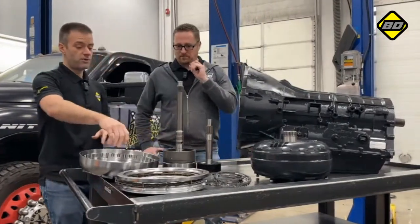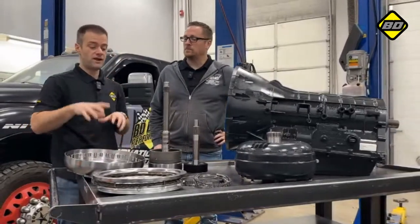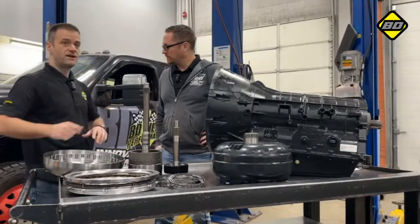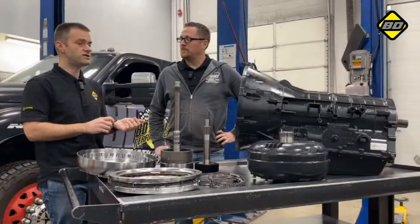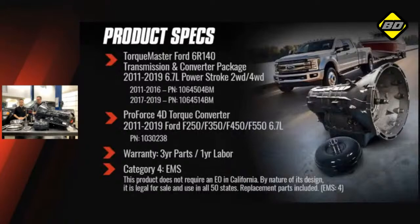One of the really neat features of our all-new converter is that it retains the factory functionality of the captive clutch assembly. Because we keep the factory damping, this converter drives just like a stock one. All our testing in the truck behind us confirms that from the seat of the truck you cannot tell the converter is a heavy-duty multi-disc. Unlike some earlier Dodge applications where you might notice a firmer engagement, this is super smooth — we call it 'smooth driving' — with super high torque capacity.